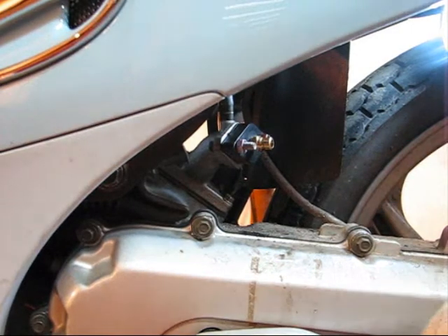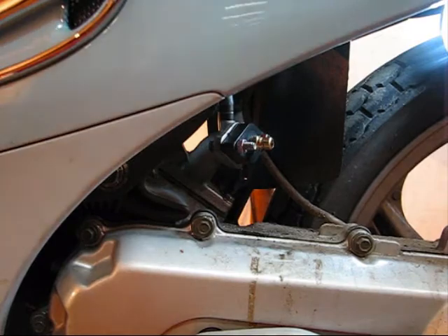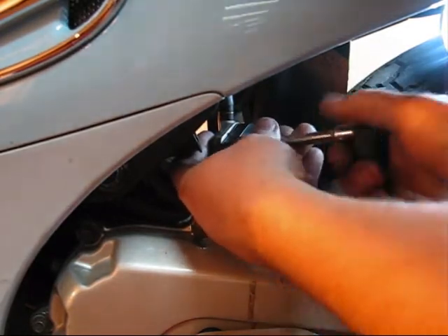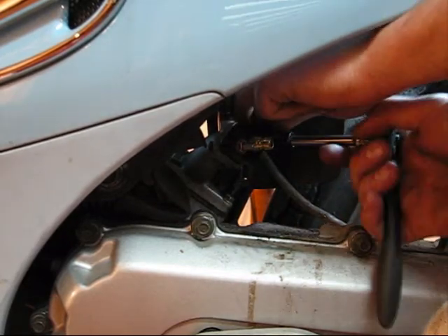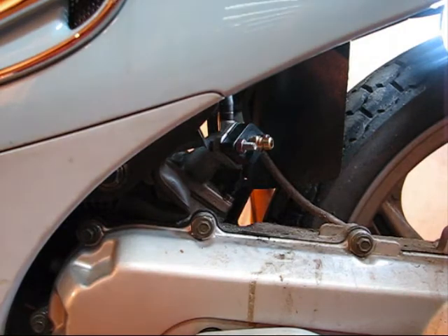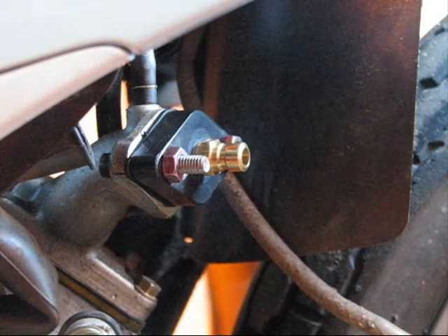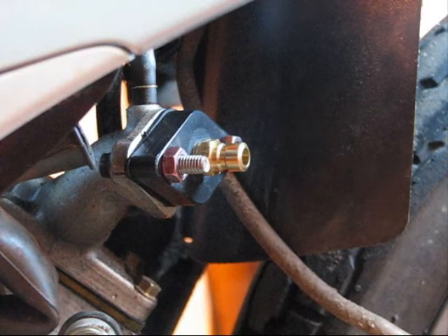And of course, just like the exhaust, we've got to snug those down. Now we've got the exhaust port blocked off, and we've got the inlet manifold adapter fastened to the inlet manifold. The spark plug is in, so this engine should be airtight.